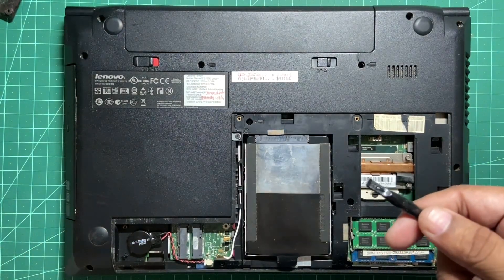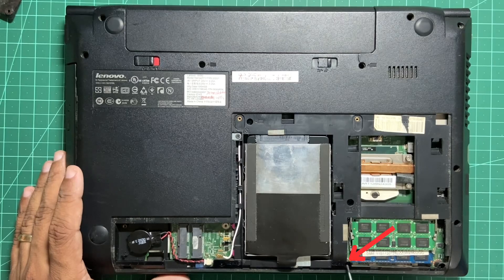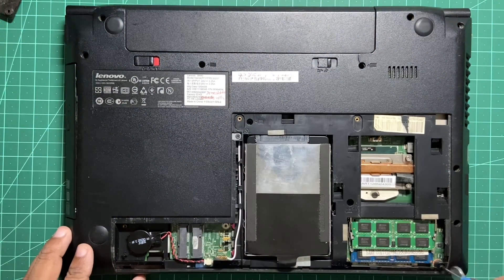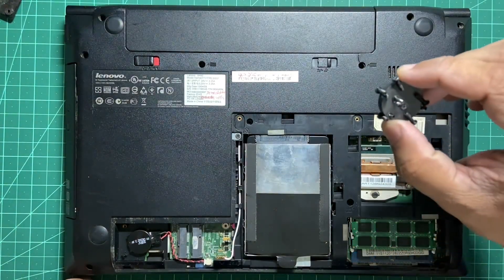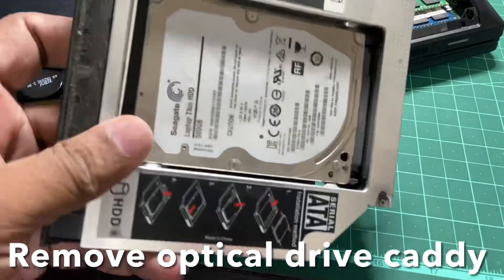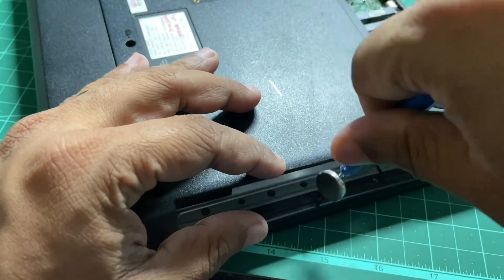If you have a pry tool like this it'll be really helpful. Once you remove this cover you have additional screws here — you can see M2.5 by 8. There's one here, one here, and another one here. Remove the hard disk as well. Be careful to store your screws properly so you don't lose them. You can remove this unit and get access to another screw right here — this is a hidden one. I'm just keeping that neodymium magnet so it's easy.